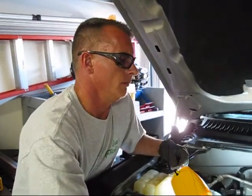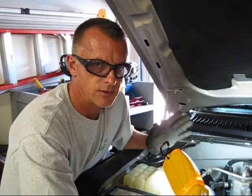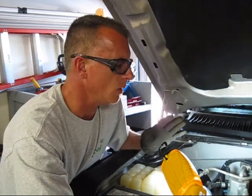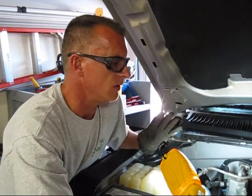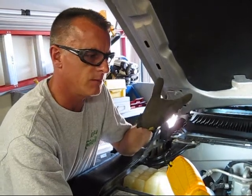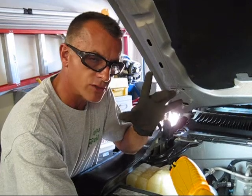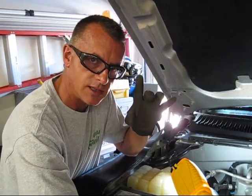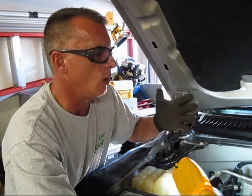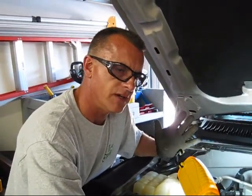So one of the biggest problems that we've had with the job so far is the 1,000 electrical connections. Every single one of these things is different. It's handled in a different way. On a whole bunch of them, there's almost like a little lock, and it separates from the connector itself. You have to get the lock off, then you can operate whatever squeeze or pinch is used as a keeper to keep the wire on. So we've gotten a whole bunch of these things off, and it's going okay. We just have to figure each one out.